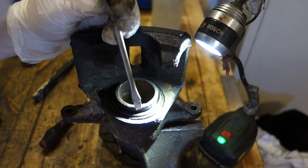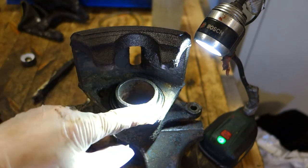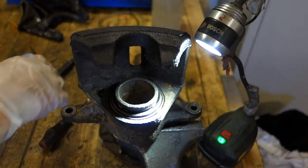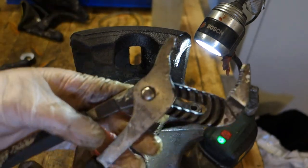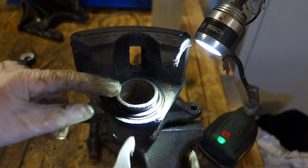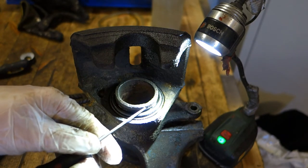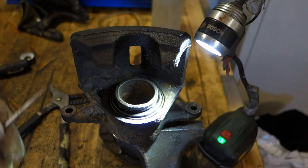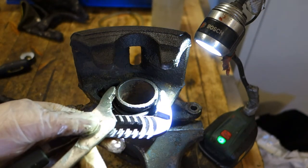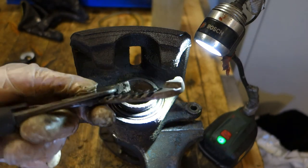And we need to check that this metallic pin is in there. And now, when it is finally in there, we can test using tongs how this piston is moving, and only that area we can take contact, these 2 millimeters in here, not in this. Be careful, this can be broken, so be very careful when you take this tong contact, very small.